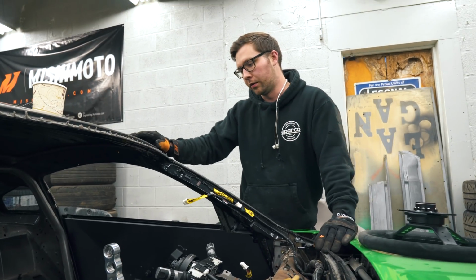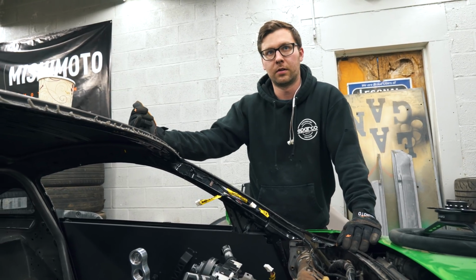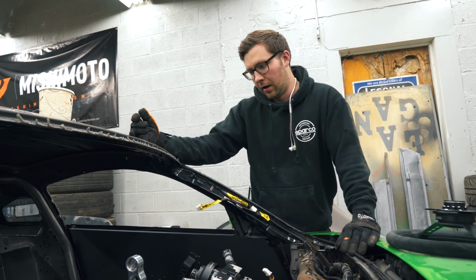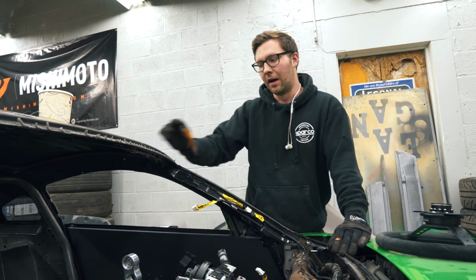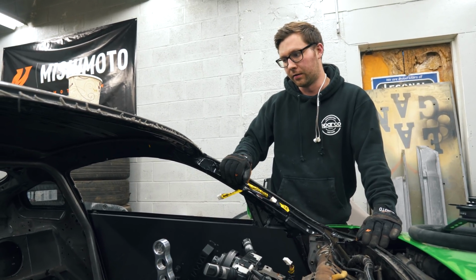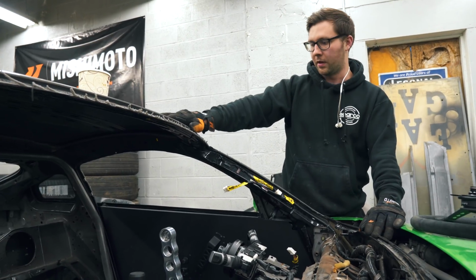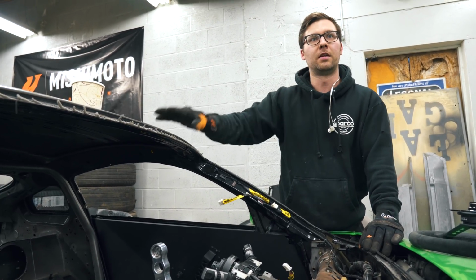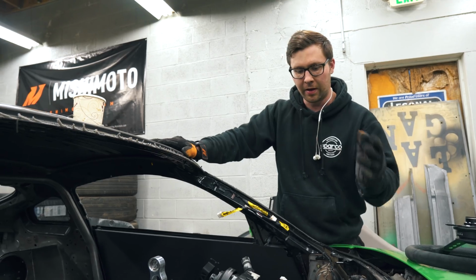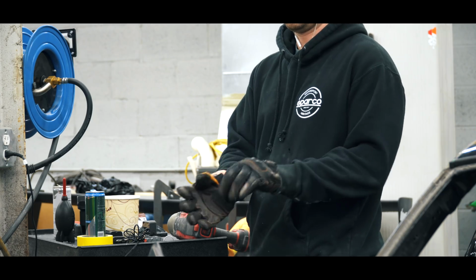The last one was kind of hard to pull, and that's why I kept changing the master cylinders on it for the rear dual caliper setup. I changed the master cylinder 3 times. I finally got the right one. So now who knows? It should lock up better because the master cylinder is the right size, and I'm gonna use the same one. But yeah, next time I'm gonna be doing sound deadening removal with dry ice, and I'll time lapse cutting that out. It's about to go down.